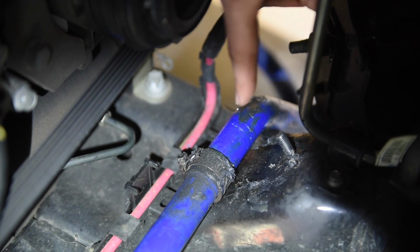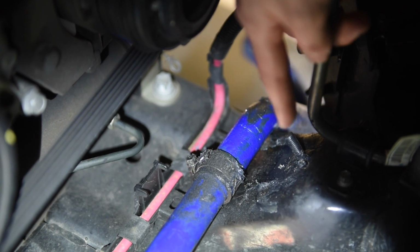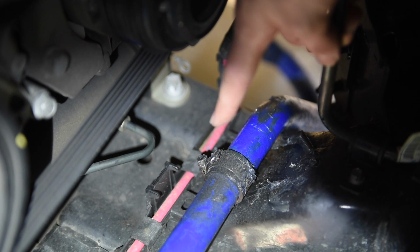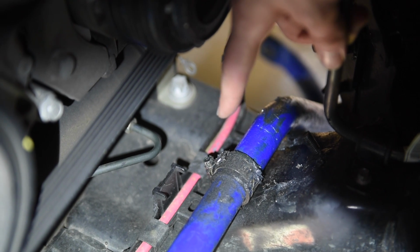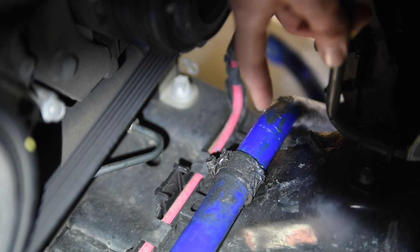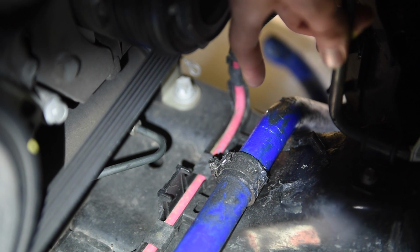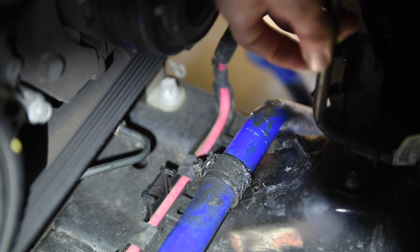As you can see, I've removed the saddle from the sway bar, and the D bushing simply slid off. What it leaves behind is two studs sticking out of the chassis, and this side-to-side retainer on the aftermarket sway bar. Now this stock sway bar doesn't have these retainers, but you might find them on some aftermarket sway bars. So the next step is to get the sway bar out of the vehicle now that it's no longer connected, and we'll show you how to do that now.